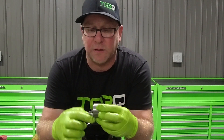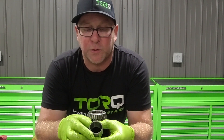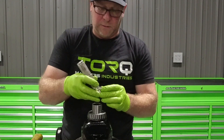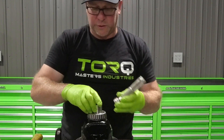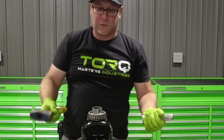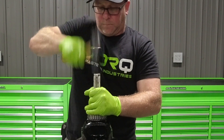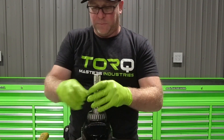The bushing is inserted into the outer sleeve from this direction. The outer sleeve has a solid surface on one side, and on the other side you can see the inner bushing — the outer sleeve has a full lip that you can drive down on nice and easy. You can use the same socket, a little block of wood, or a driver kit if you have one. Make sure your bushing is in the right direction and tap it gently to get it started. Make sure it's going in straight. Drive it until you feel it bottom out and want it flush with the outside of the carrier — don't over-drive it.